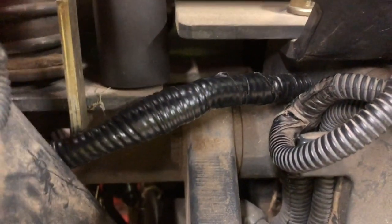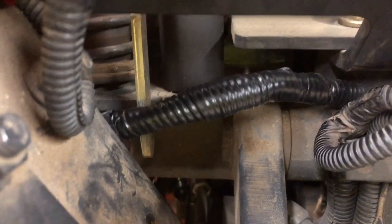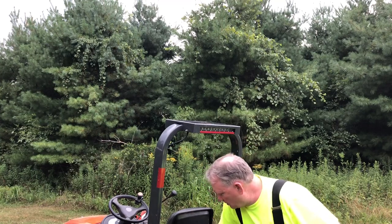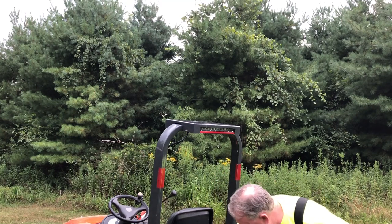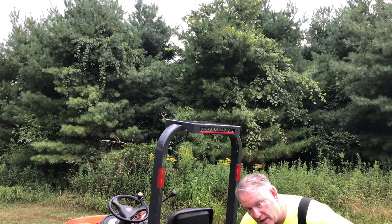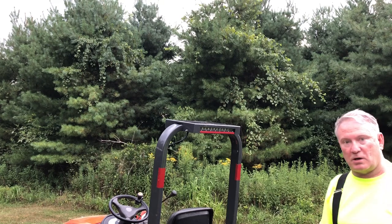So I ran this wire down. I have some cable tie-down clips and some tie wraps. I put a quarter-inch wire loom, ran it down through a hole here, put the wire through, then came up, plugged it in, covered it with more wire loom and then taped it up. It's a very, very nice installation. Unfortunately, you can't see much because it's all covered right now.